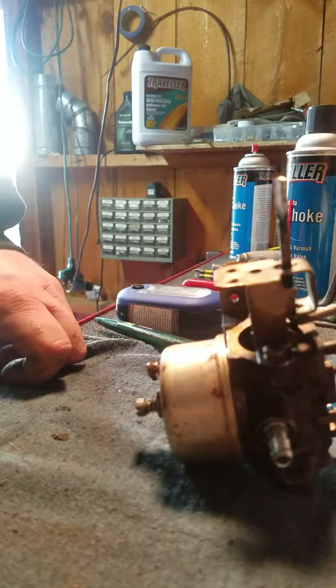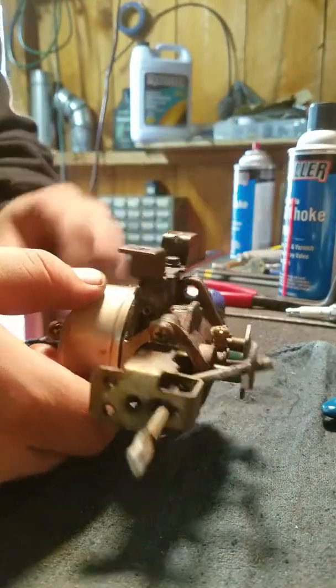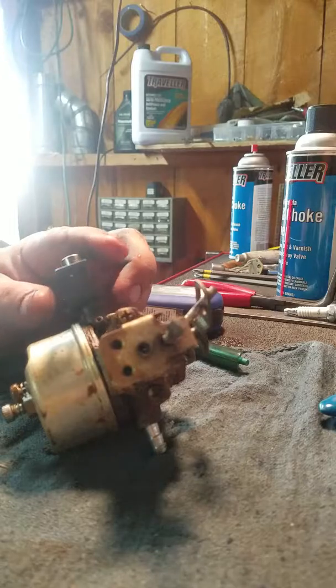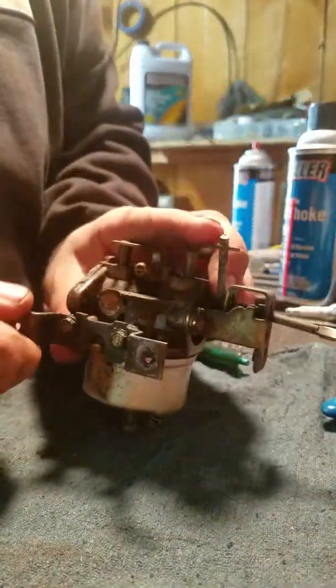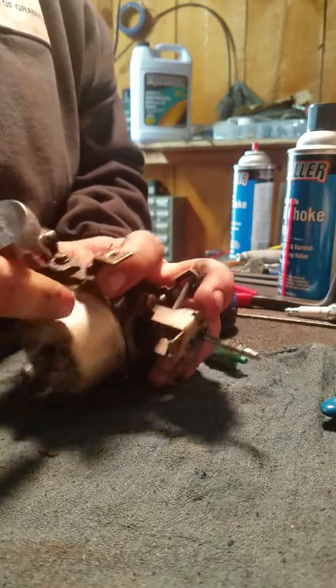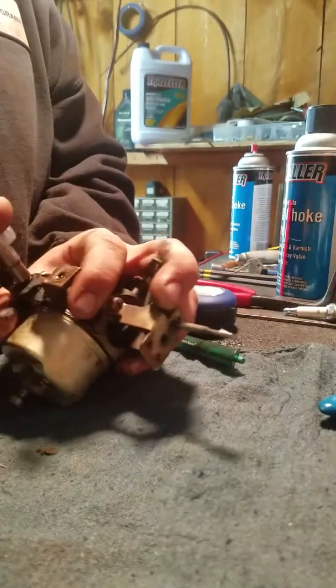This carburetor plate is loose right here, so I'm going to see if I can tighten that up because that shouldn't be loose. It probably rattled around and wore it all out. A quarter-inch ratchet — a couple little turns. You don't need to take this off or anything either, other than maybe this — there's a jet right here. You do have to take that out and clean it, but this should sit up out of the way enough to get that out without having to take this off.